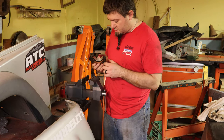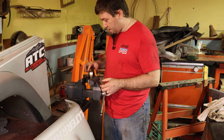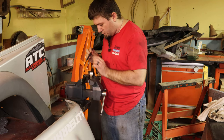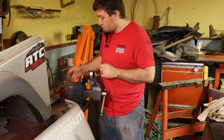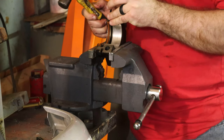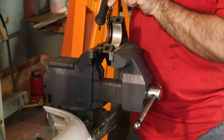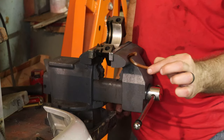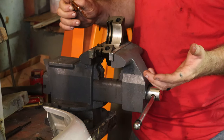I know that because I did this years ago on my old YJ. It was a slightly different setup then because the YJ did not have that girdle. While I was trying to get the seal out or put the new one in, my finger slipped and caught one of these corners, and I put a huge gash in my thumb - I may even still have a scar from it, that's how bad it was. That is half of a rear main seal. I'm going to clean this up, maybe spray it with some brake clean, and then put in the new seal.